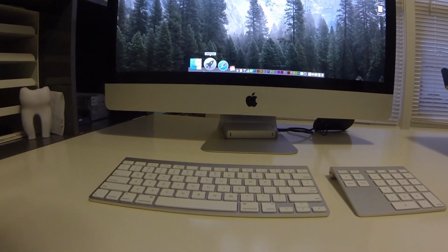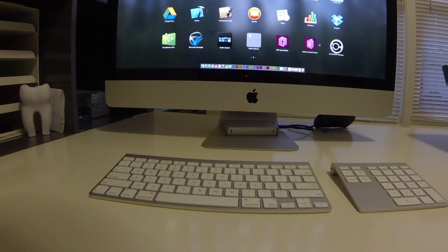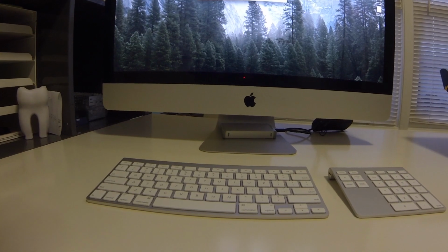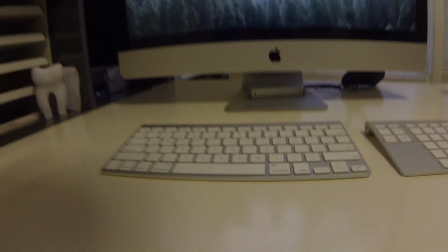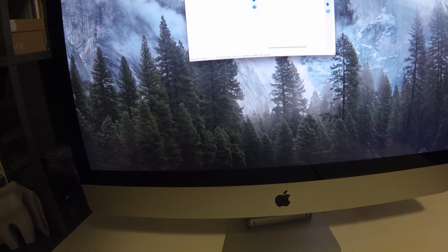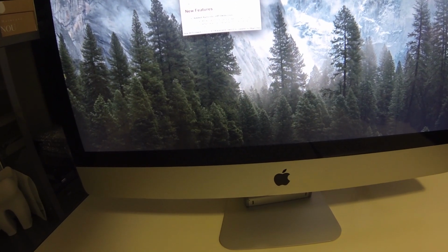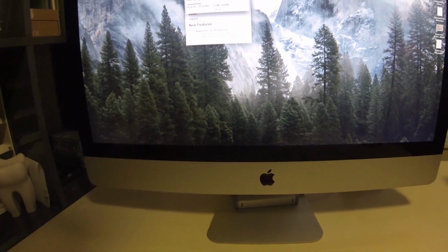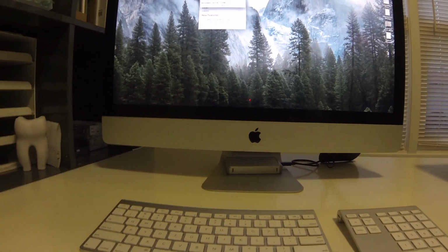So I'm on a Mac. I'll go to my Launchpad, scroll over to my app, which is the Accessport Manager. Open that up. Now that I have it plugged in, it shows that there's a new firmware update. So I'm going to go to updates right here, click that, and then go to begin firmware update. It's downloading the file right now, updating the firmware on the Accessport. It's about a 30 megabyte file.